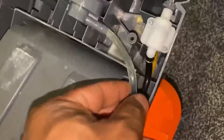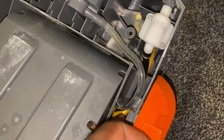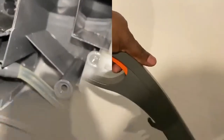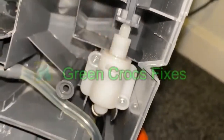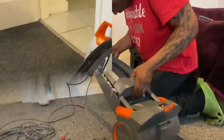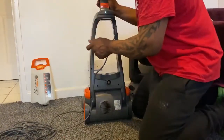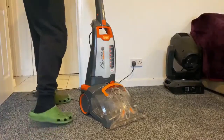Then you just have to test — make sure these cables are not snagged or kinked. When you press the orange lever, this is what happens inside — you can see it operates the actuator. Just to give a demo: when you're pressing this handle to supply cleaning fluid, this is what happens inside. Make sure that action is working and the linkage is working. Now that's done, it's just a matter of reassembling the unit — a bit tricky this part — and putting the screws back in.